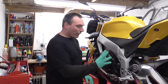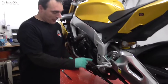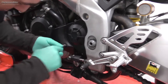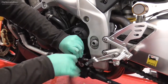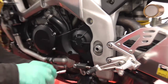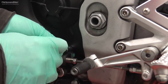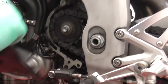The first job we need to do is take off the front cover and undo the front sprocket nut, which may be very tight. So we're going to put the bike in first gear and see how tight it is. It's three 8mm bolts. This bottom one is a little awkward, but I don't think you need to remove the gear shifter.